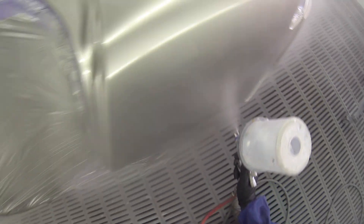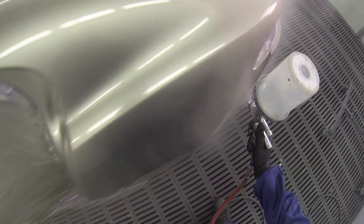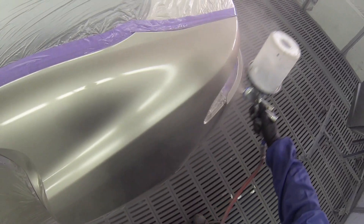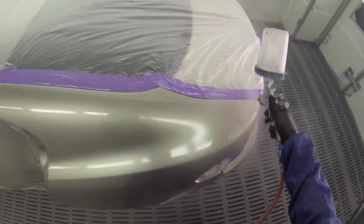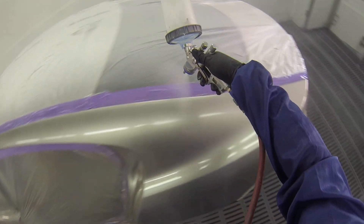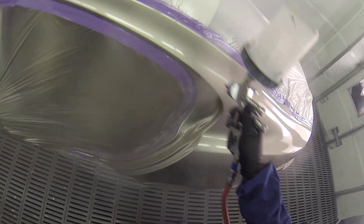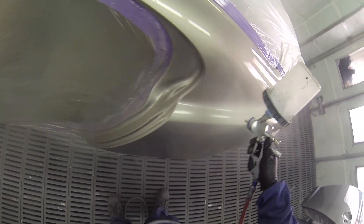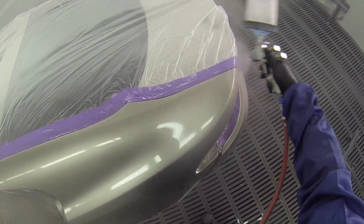From memory, this was a pretty warm day when I painted this. It looks like I'm bashing that clear on quite well, and I'm going to guess it dried a lot quicker than I wanted it to — seeing as we were smashed up with work and trying to get as much done as possible. I probably would have used a fast hardener instead of a medium hardener, just bashing it a bit harder to make sure it stays wet.